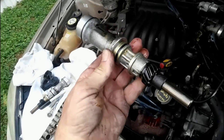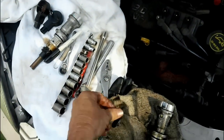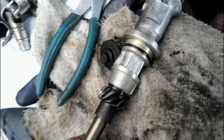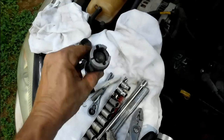Got the cam gear out, and it's a little bit hot. Here is the bolt that holds it in — a little 10 millimeter. I used a swivel to get down in there, and it comes right out. I did spin this and I heard it squeak — it squeaked one time, so it is bad. So now I'll go ahead and stick this new one in.